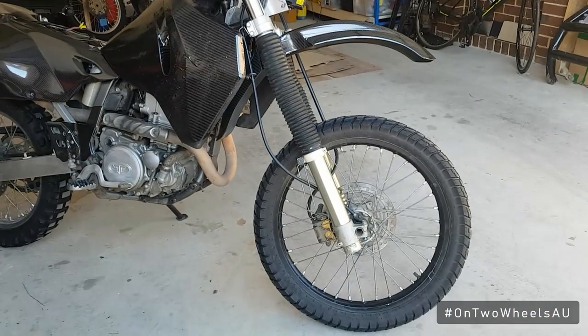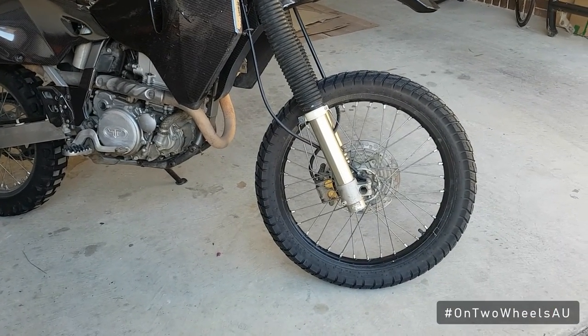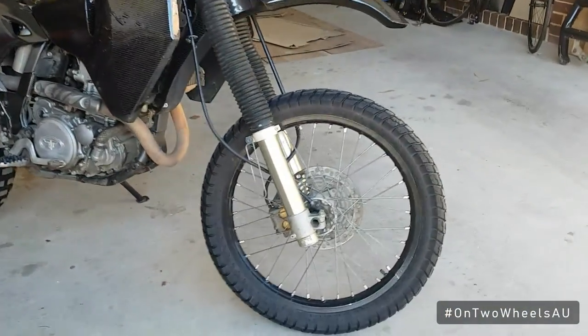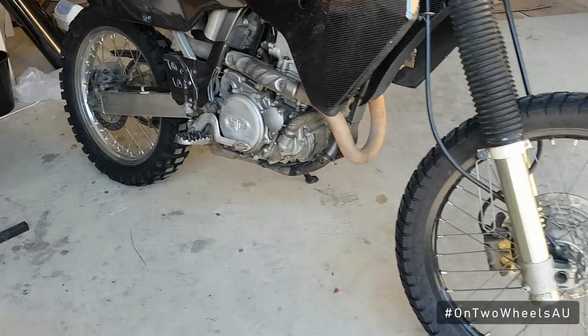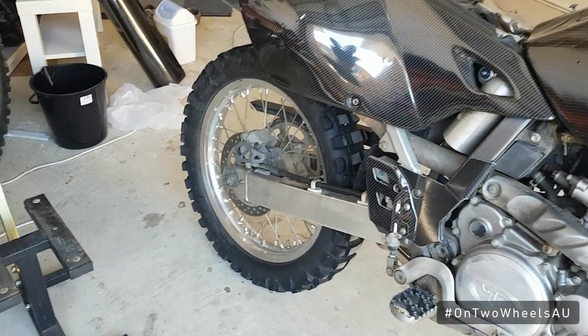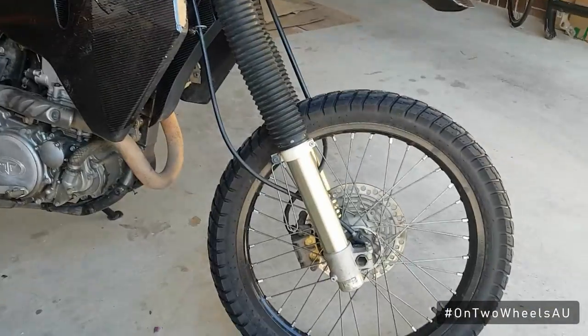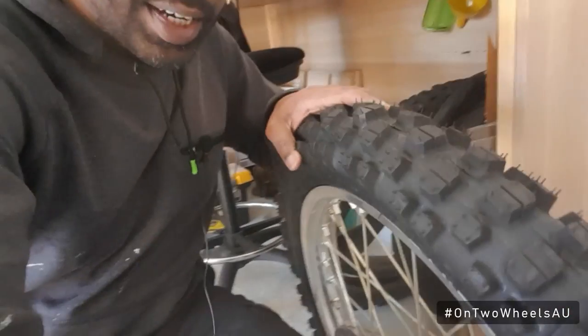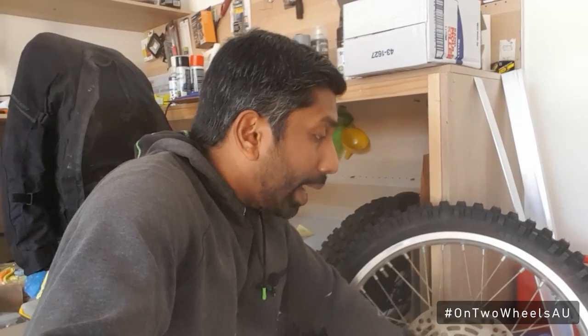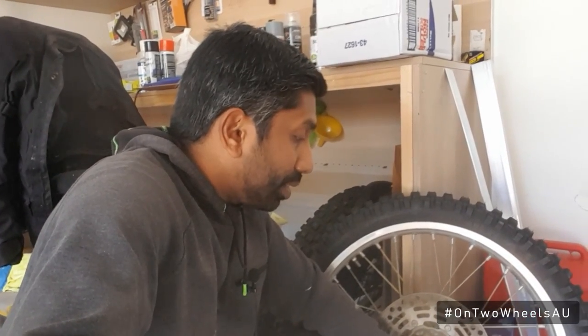Right now on the bike I've got the road wheel on the front and the off-road wheel at the back, which gives a quick comparison. The front wheel has a much nicer, deeper color and finish, whereas the rear looks very 2012. It'll be nice to give it that same black, dark look. I also got a new front tire while in lockdown — a Pirelli MT21 with a pretty aggressive tread, looking forward to riding on it. Before spray painting I need to make sure the wheels are clean and oil- and dust-free, so I'll wash with soap first and then use a degreaser.